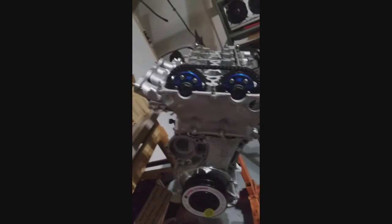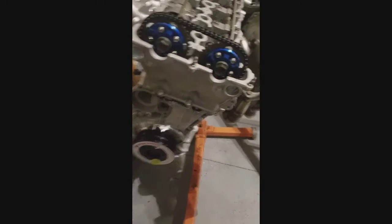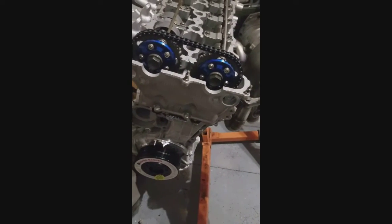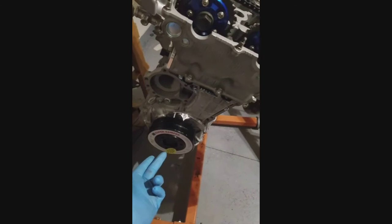The first thing you've got to do is put this thing at top-dead center. This is for people that have done a head gasket and they don't know where all the colored links are, or they just took their engine apart and they're putting it back together and they still got the front cover on and the oil pan on. Because they locate the links and put the silver link on the bottom, you've got to remove the cover and take off the oil pan.